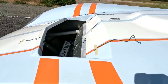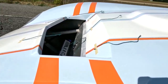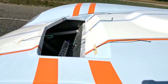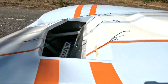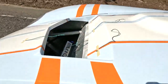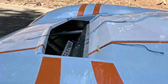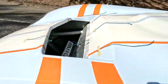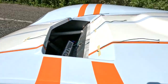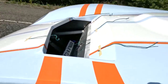The shocking part was if you look down inside the opening, you see the yarn - it goes to the front of the oil cooler, power steering cooler, and then to the actual aluminum there, and it's getting sucked right up under the hood. I think that's because there's a gap there of about 600 thousandths of an inch. All that air is getting sucked up into the engine instead of being exhausted out the top - so that's definitely an issue.